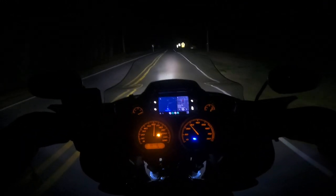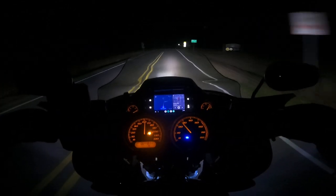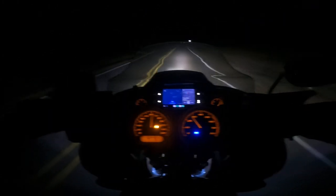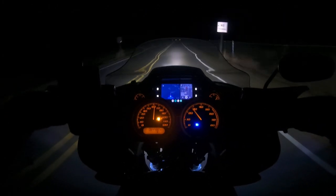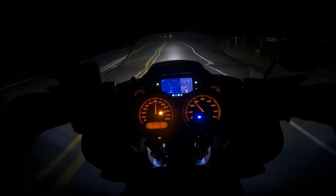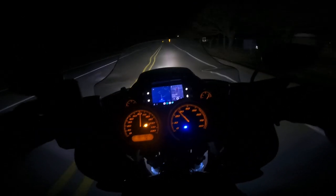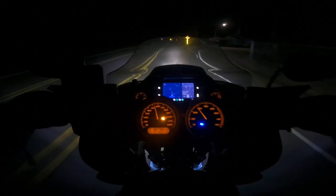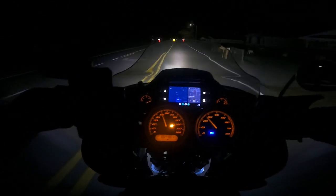I already had an LP6 sitting around, and I decided I'd throw a Jeep light in, wire it up, and fit it into the LP6 harness that I bought. That was pretty easy. You just get a Deutsch connector — a DT connector, a little 4-pin connector — and look at the wiring diagram for the Jeep light and just pin it out correctly.